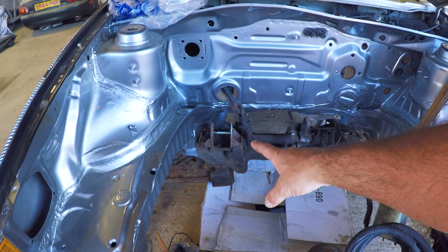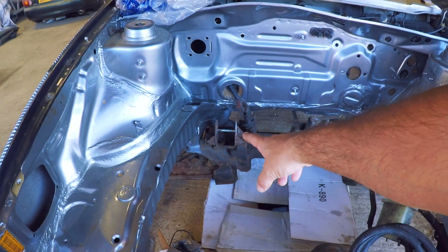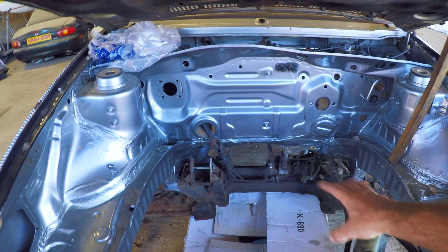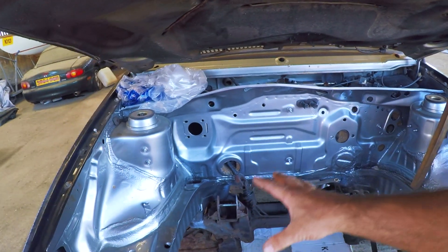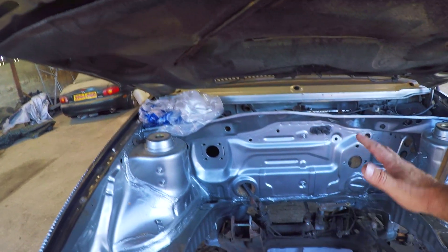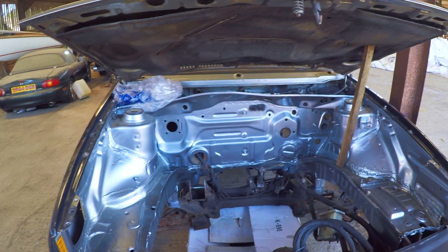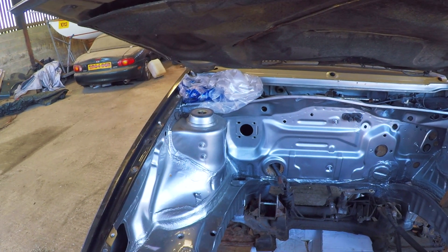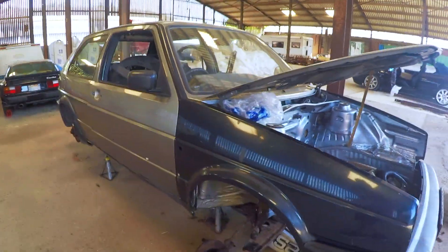You can get Vibratec mounts or even the latest-spec 1990 16-valve mounts — they're okay — but the subframe is still inherently not the greatest because of the wishbones and the bushes in the rear. The Mark 3 subframe is an improvement mount-wise for resonance going into the car, and for an old car it just feels nicer when it's a little bit quieter. It's got so much character, and just taking a bit of resonance out makes it more enjoyable to drive. So we're going to remove the subframe and go wide-track GTA-plus wishbones, anti-roll bar, and hubs to improve torque steer, and Powerflex all of those.